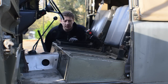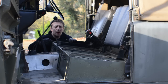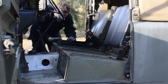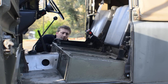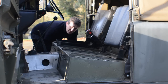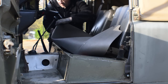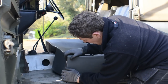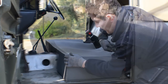We're going to lay the seat box matting over the top — it's just going to sit there for now. We've made the aperture for the handbrake and then we're going to try to mark all the exposed pieces and the areas around the seats that need to be cut out. One thing I didn't mention: this matting is incredibly heavy — that's the idea, it absorbs all the sound. You might struggle on your own, so if you can get two people to do it, it's worth it. Make sure you pull it in nice and tight before you mark it.